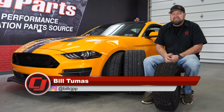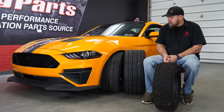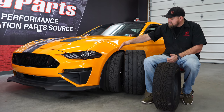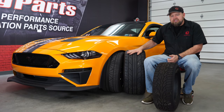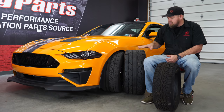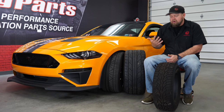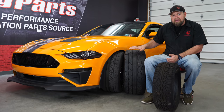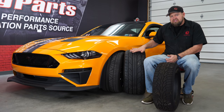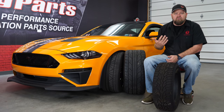The first thing we're going to discuss is tires. When it comes to a rear-wheel-drive car like the Mustang, tires are going to make a huge difference on how well your car does in winter weather. If your car has something like the Nitto Invo, the G2s from Nitto, the Pilot Supersport, or the factory Pirelli P-Zeros — these are summer tires. This tread is designed for maximum traction on dry roads. They do have channels and will work in the wet, but these are absolutely not meant for winter use, especially because the compound gets harder when it gets colder, making traction even worse.